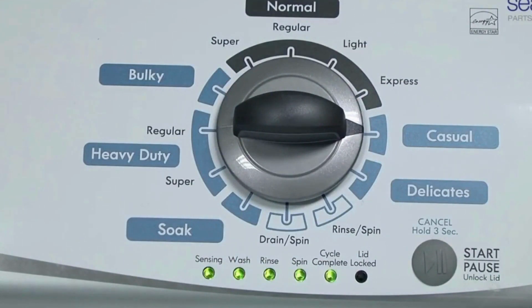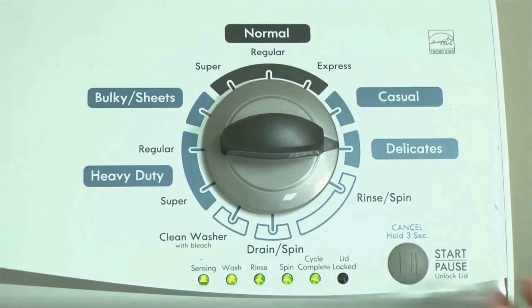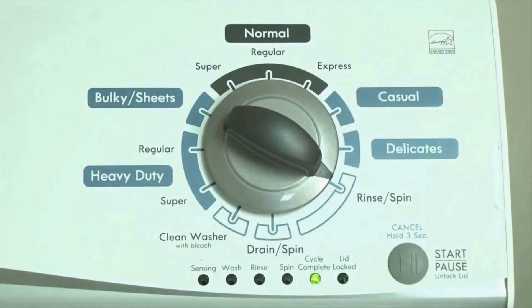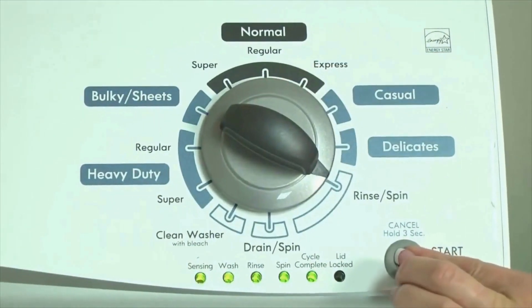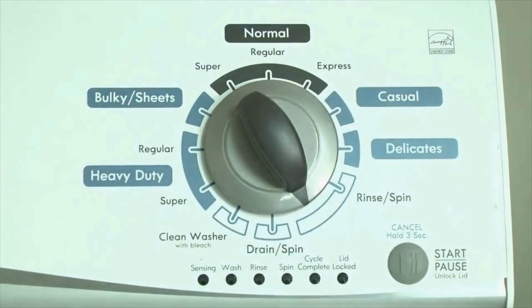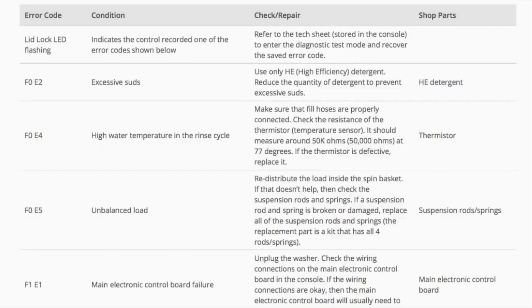All the green status lights blink when you successfully activate the diagnostic mode. If the status lights don't blink, try again and maybe try turning the knob a little faster or slower. Congratulations — now your washer is in diagnostic mode. Now we need to retrieve the codes. Follow these steps to display the error code lights. Step 2: Turn the control dial 1 click clockwise, then press the start button. Now you are reading the error codes.